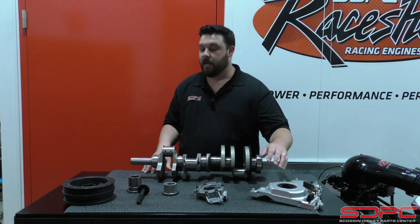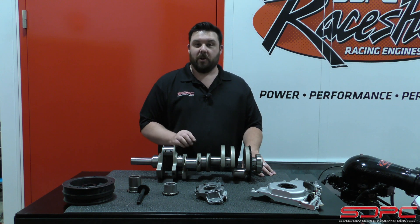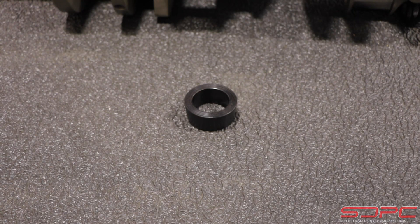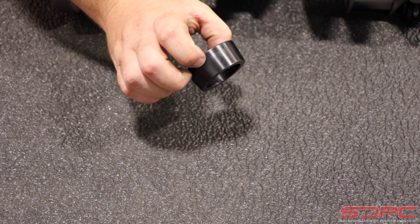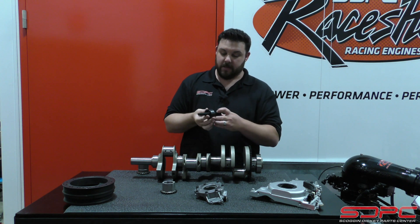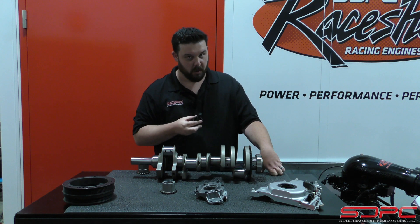You'll then put on your front timing cover, and next is your balancer. The balancer is different between wet sump and dry sump, so we make sure to include that in our kit so there's no confusion. The next part you're going to put in right before the balancer bolt is actually the spacer. Essentially what this does is take up that extra slack — you put the timing cover on, put the balancer on, and you'll notice there's more of the crank snout sticking out. It's a nice thick machined steel spacer made to take up that slack and the extra bolt length. We include a dry sump bolt in our kit — do not use a wet sump bolt with these kits.